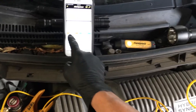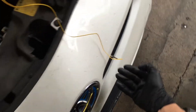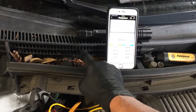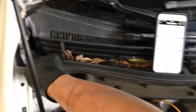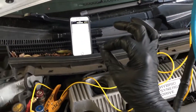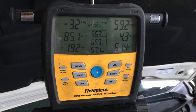The air temperature right here is 77 degrees. So we have 55 degree air going into the condenser and radiator, then it goes through the fans over the engine, gets sucked down right here, and at that point it's 78 degrees. It's mixing with a little colder air on the sides, and what comes out of the dash is 69 degrees — plus only a minute amount of cooling being provided by the evaporator. Let's see if I can pinpoint this leak.